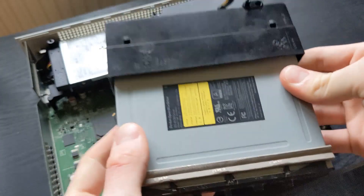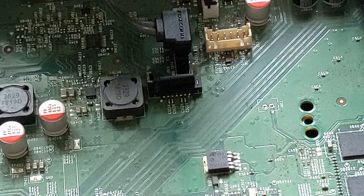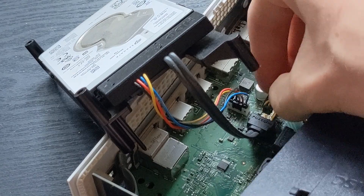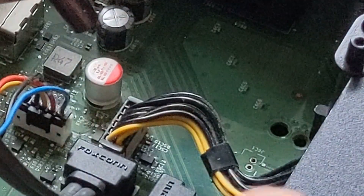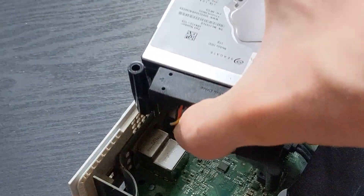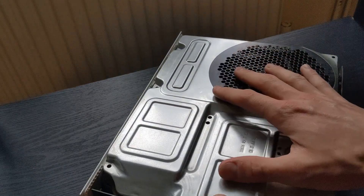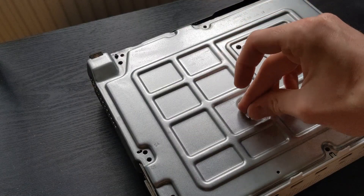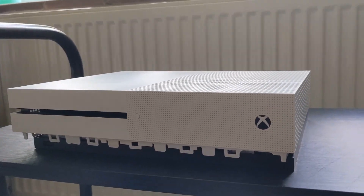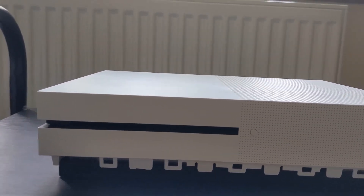Grab these two cables and plug them in. The gray connector goes on the right — you can see by the ports they're the same. The next one has a missing notch and a missing pin, so line them up with the missing notch and pin on top, with the cable facing down. There's our Xbox. Put the disk drive back in by lifting up the hard drive to access the ports underneath — the SATA ports are easy to tell apart. Make sure the disk drive pins slot into place, then drop the hard drive in, pop the cover on, and screw everything back into the corresponding holes. There we go — you really don't need a soldering iron to replace the disk drive. Stick the console back together and you're good to go.